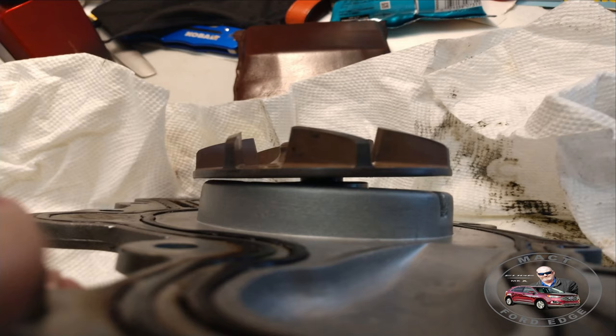But hey, we took the water pump off, and as you see in this picture, she's a little bit on an angle, and that's because all the bearings inside had failed. Coolant had managed to get into the shaft and destroy the bearings. And in that process, those bearings started grinding away. They started flipping and doing all sorts of weird stuff. And then, of course, we ended up with problems.